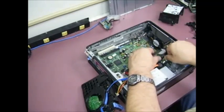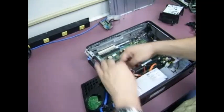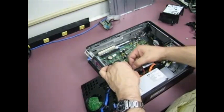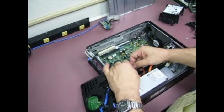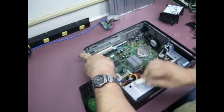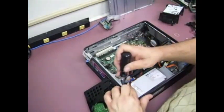You'll also need to disconnect the four-pin power cable and the 24-pin power cable in the back. Sometimes that one is a bear to get off because the cables are so tight they don't give you much to work with. You can remove the little cable tie that ties the power supply cable to the front panel cable to get a better grip. We also have the SATA cable that needs to be unplugged, and then there is one more screw in the back corner.